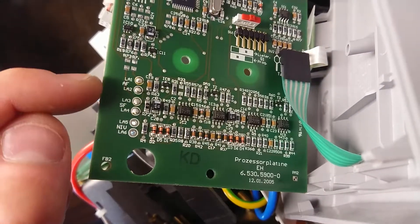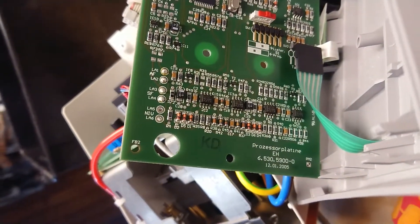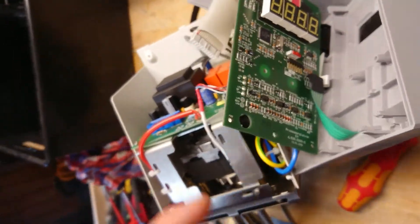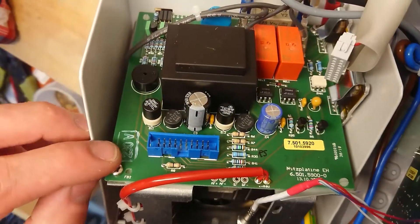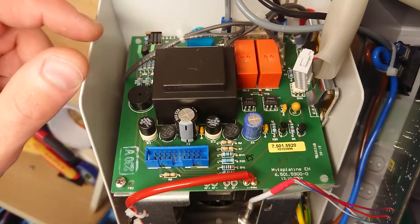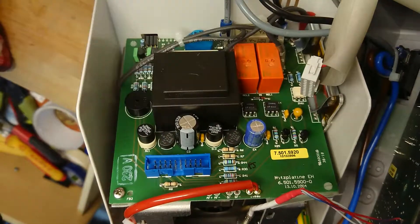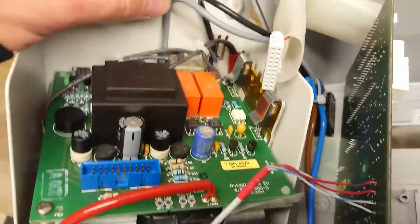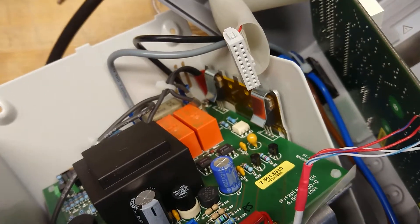It seems this platform might extend to other different kinds of apparatuses with different purposes — a common platform they may use for others as well. You can see it's a 230 volt unit. We have a control power or maybe the pump motor transformer sitting here. Other than that, there are only a couple of relays, and as we did not hear anything click, I'm pretty sure the heating element is switched on and off by these two transistors or SCRs.